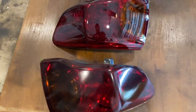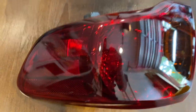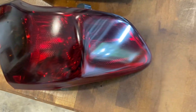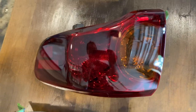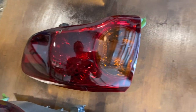I just wanted to show — I did a clear coat on this one and wet sanded it. This is what it looks like with the clear coat after wet sanding the base coat, and this is what it looks like with just the VHT, no clear coat, no sanding. As you can see there is a big difference with the clear coat, and it's also going to protect it and make it last longer. So I'm going to finish wet sanding all the base coats and then give them all a nice glossy coat.